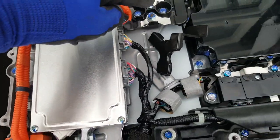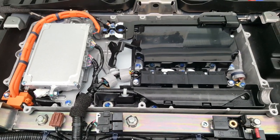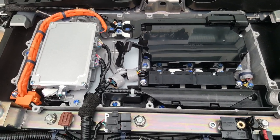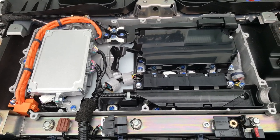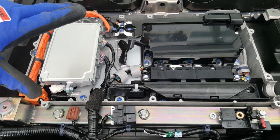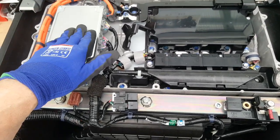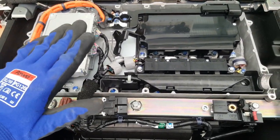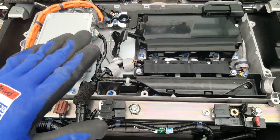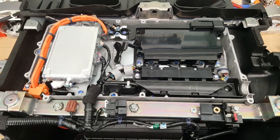So we have access to the positive and the negative without taking the battery out of the car. I can add an Anderson connector onto there just for testing on my own car, without having to take all the trim out. The car won't sense the current at that point because it's before the battery current sensors, so we can put power into that point. The only way the car will know about it is that the cell voltages will slowly rise as they charge up, and hopefully that will equate to an increase in usable capacity and state of charge. So we'll see if we can just use a simple buddy pack — that's what I'm looking at at the moment.